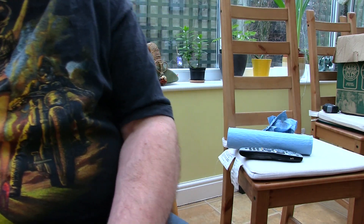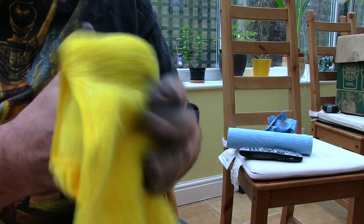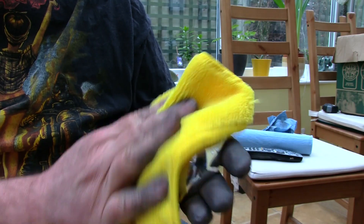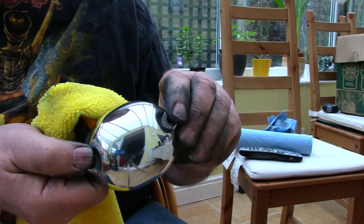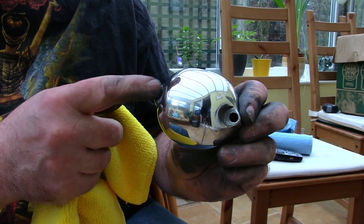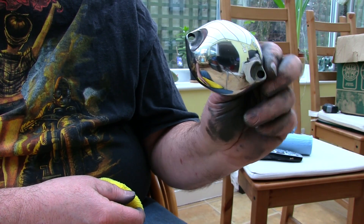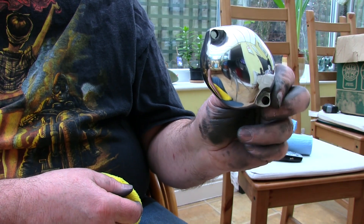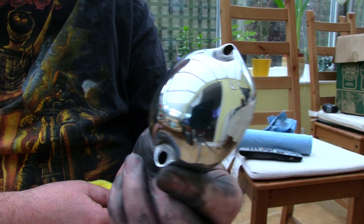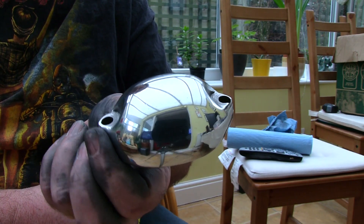At my very final stage now, just polishing the rocker cover with a microfiber cloth — and that's how it's turned out. After all the work it's almost like chrome, it's beautiful. I'm going to use a little Dremel just to get the recessed bits cleaned before it goes back on, but considering this was a damaged one I didn't think was capable of being brought back to this standard, I'm really really happy with that. That's hand polishing — I'm so glad I came across that video and I'm able to share it with you. Thanks for watching.